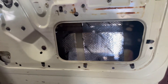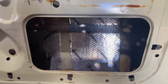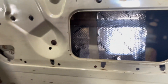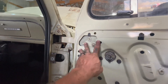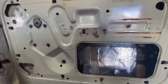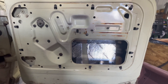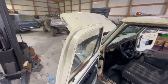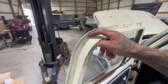One of the things on this truck I did to try to quiet it down was put some sound deadening mat inside the door. I put it all over the floors, the headliner, and everything. I'm also going to cover these holes up with some sound deadening — I'm sure there was probably some sort of plastic thing from the factory, but I don't have it anymore, so I'm just going to use sound deadening mat. In the later years, like 1977 or 1978, they started putting a little bit of foam right here.